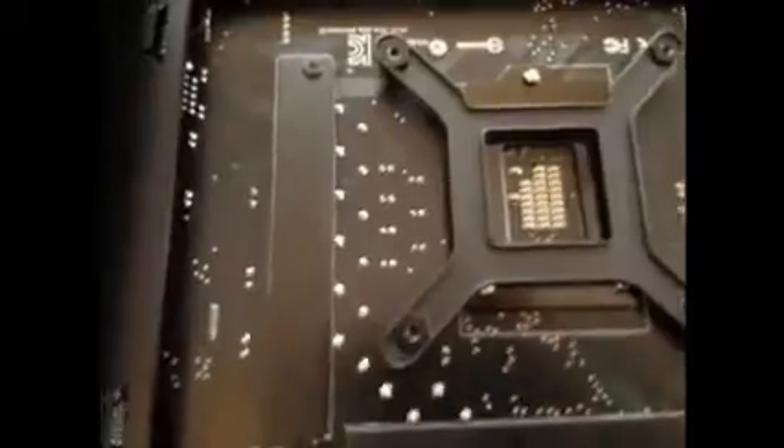All we're going to do now is take the little back plate off and unscrew the standoffs. The standoffs you need for the i7 or Intel chips are the ones with the longer side screws — each side has long screws. The other ones in the pack have one long side and one short side; those are apparently for the AMD chip. But obviously we're doing the Intel chip.